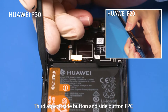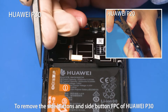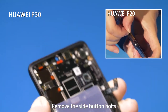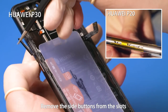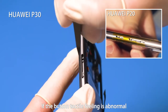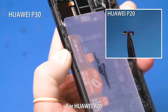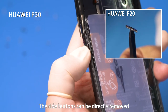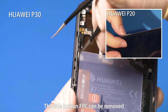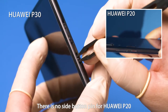Third aspect: side button and side button FPC. To remove the side buttons and side button FPC of Huawei P30, disassemble the phone first, remove the side button bolts, and remove the side buttons from the slots, then remove the side button FPC. If the button tactile feeling is abnormal, the side button pins inside the side button slots can be replaced. For Huawei P20, the side buttons can be directly removed without disassembling the phone beforehand. The side button FPC can be removed without removing the side buttons first. There is no side button pin for Huawei P20.